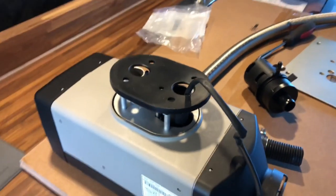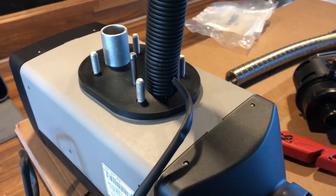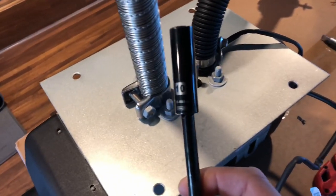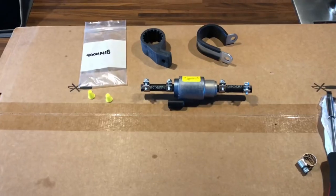Take a quick inventory of all the pieces you're going to need for this installation. My kit for some reason was missing three parts that I needed in order to complete my install. Assemble the heater components with the rubber gasket going in first, followed by the steel plate. Fasten down using the provided 10mm bolts and washers.